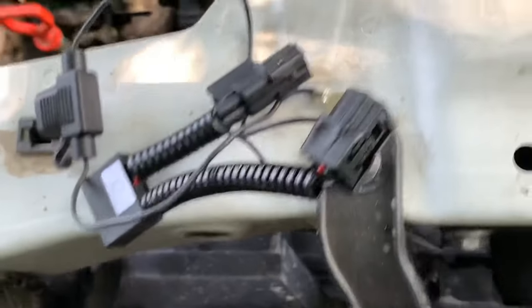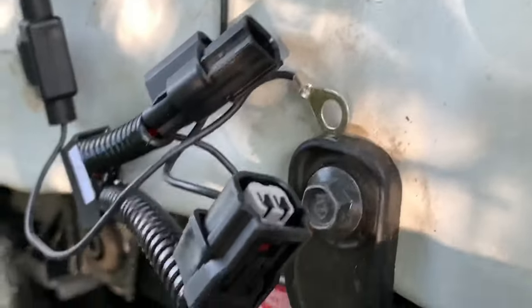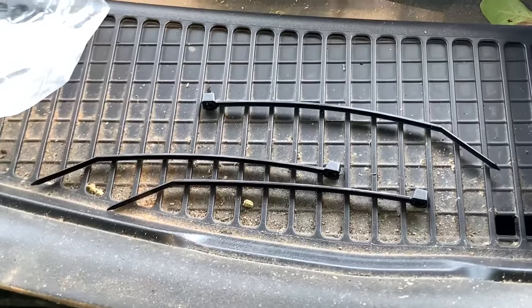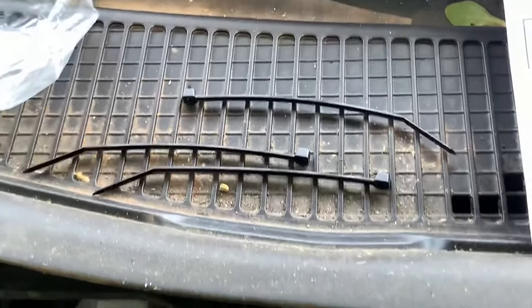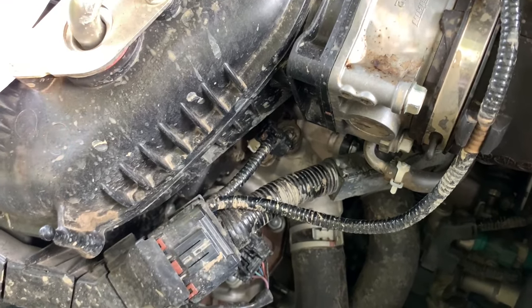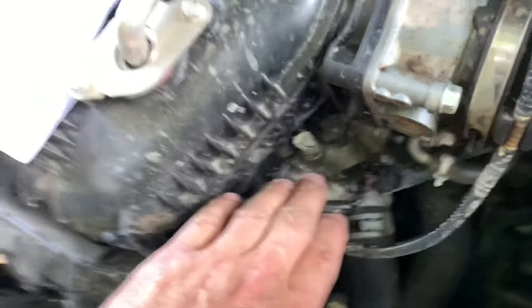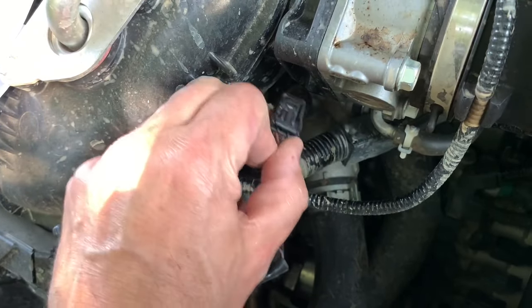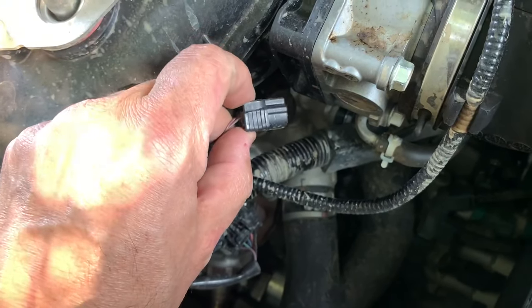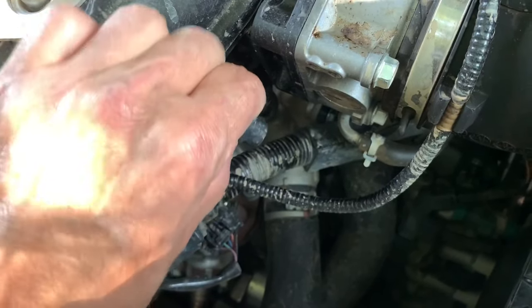Out of the back, this is what it looks like. You're going to have a male and female plug that plugs in. You're going to have a fuse in here that you're going to run over to your battery and connect. It comes with four zip ties — be careful when you take it out of the little bag because you'll drop them in the engine compartment. So make sure you do this when the vehicle is completely cold, because you have to put your hands up against — it actually looks like plastic back there and the plug itself is in the back. So you're going to have to get one of your fingers back there, push it, and then use your other hand to pull up this way.